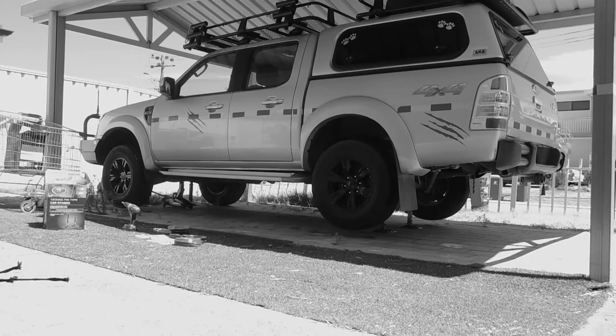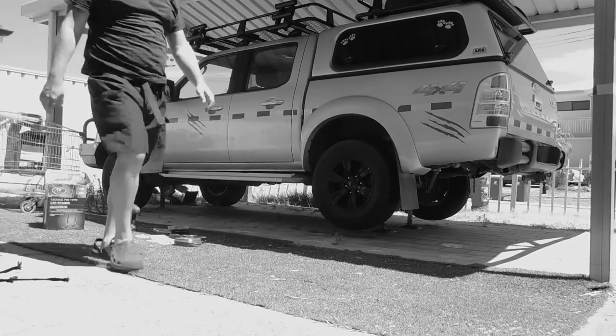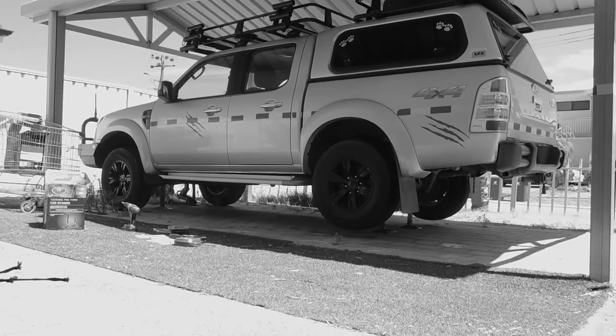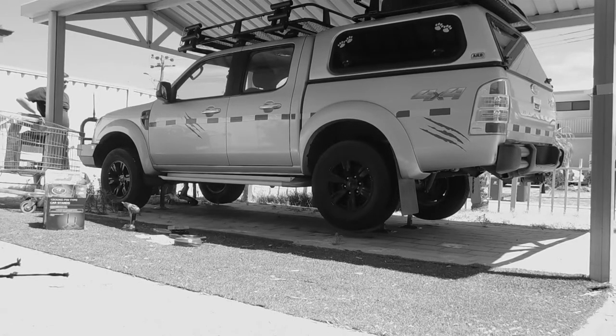Chapter 3. We then unscrew the differential breathers with a spanner and then mount the new breather with airline attachment. This is located at the top of the differential. This is usually used to fill the differential up with oil for lubrication, being careful not to over-tighten the breather, as this is aluminum and is not strengthened and is very weak.